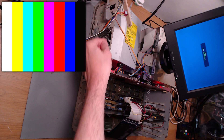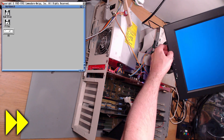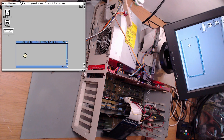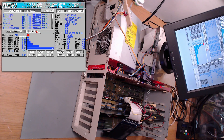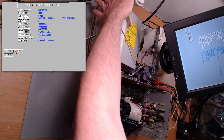It should just boot my GVP card like before, but maybe just a little bit faster. No extra RAM and it doesn't really feel any faster. Let's take a look in Sysinfo. After a quick speed test it looks like a normal system, and I can see 8 megs of fast RAM coming probably from the GVP card. Although that's configured at 4 megs so I'm not quite sure what's going on there. It looks like right now this card isn't doing anything.